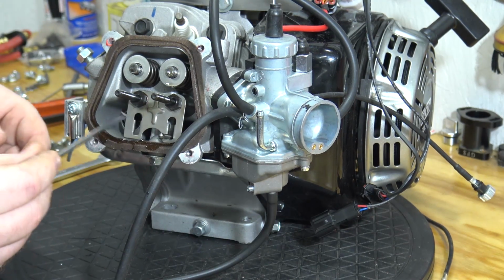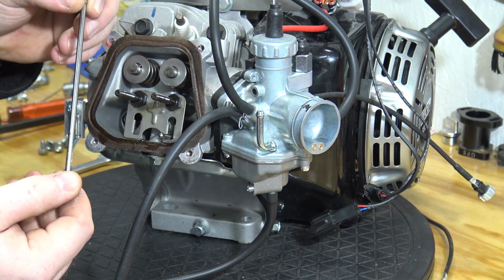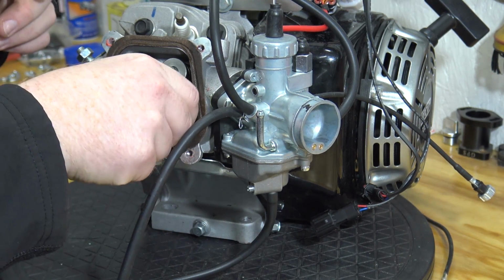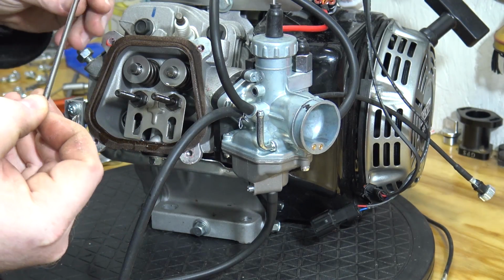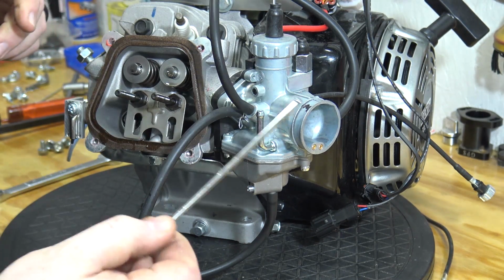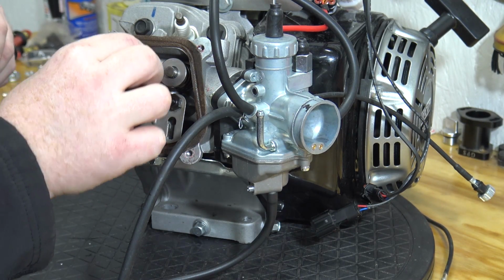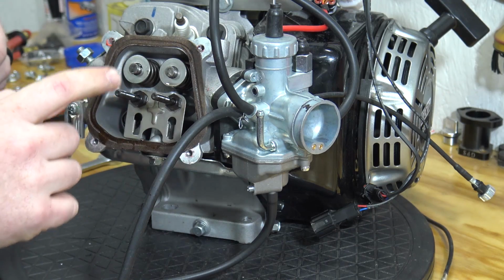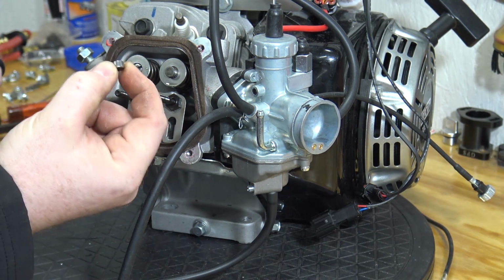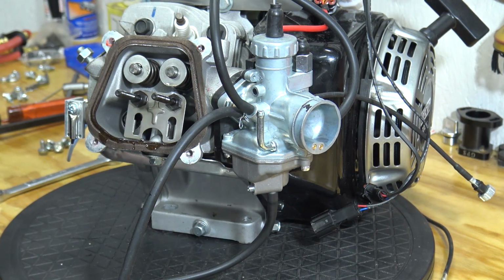Alrighty. Push rods are out, and they do look maybe a little bit beefier than what you would see in a stock Predator non-Hemi, but I'm not sure. I'll have to talk with them. They don't look Chromoly or anything, so we'll probably be replacing those. We don't have to mess with the valves any, but it does have a different set of retainers and lash caps than I've ever seen, so that's different. I'm wondering if it has stainless valves in it as well.